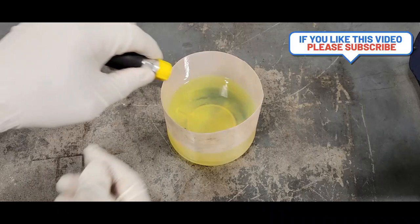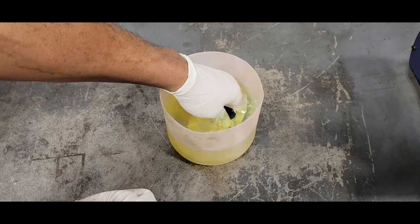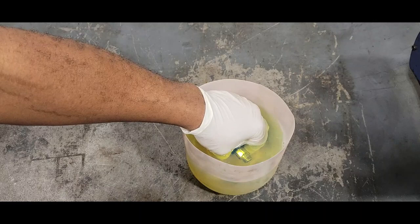This is not necessary, but I'm going to take the new primer and just drop it inside a little bucket with diesel fuel. I'm just going to pump it and get as much air out of it as possible — just going to pump it back and forth. Like I said, this is not necessary; it's just something that I do. Then I just go ahead and screw it on to the unit.